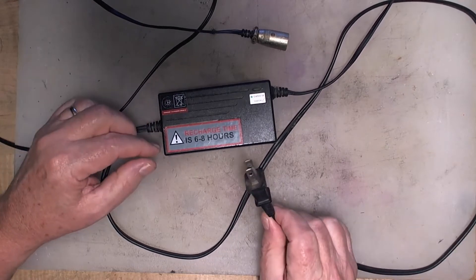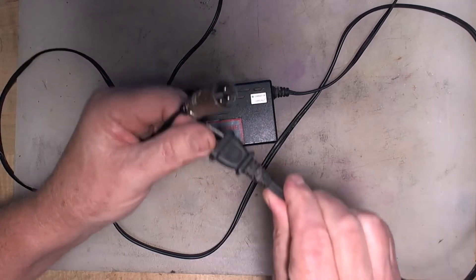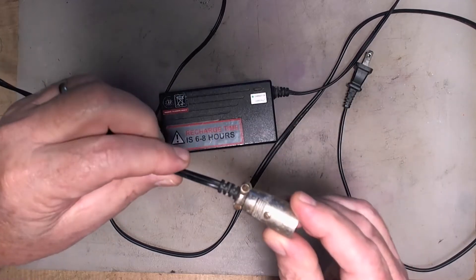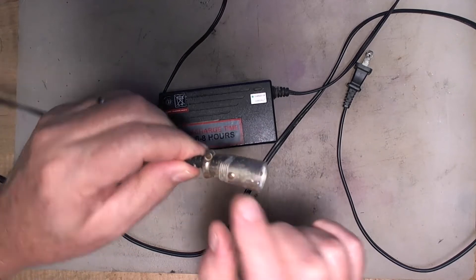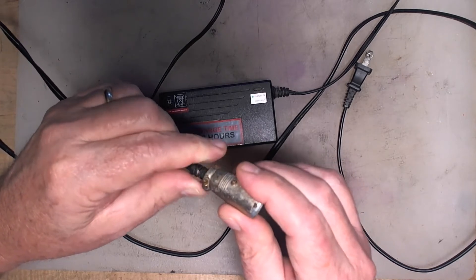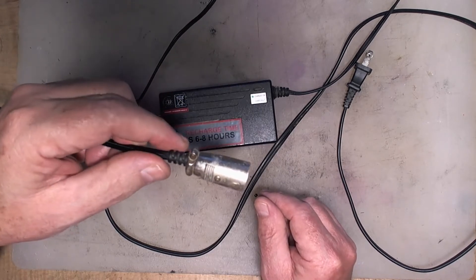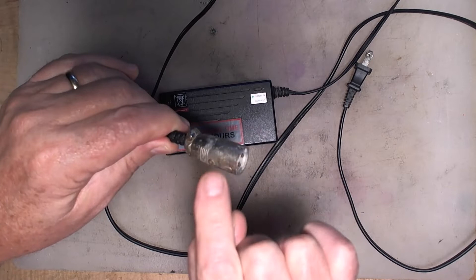The next thing is to look at places where the cables bend a lot, and that's usually right here. This part of a plug is strain relief so that it doesn't bend at a sharp angle. That's alright, but this one doesn't look so good - it's got a little bit of strain relief but it looks like that might be a problem. Another area is inside of a plug like this, and usually I just give them a wiggle. If I feel anything wiggling, that's not a good sign - they need to be taken apart and the leads checked. Also, because it's a scooter that means kids are probably doing the charging, which means they're going to yank it out as they go out to play. So that is always suspect.